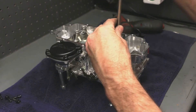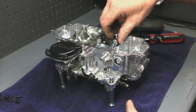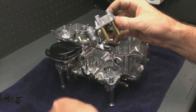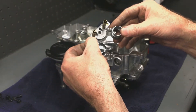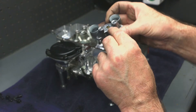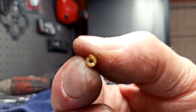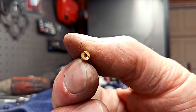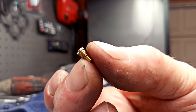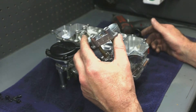The other thing you can do with these — which you can't do on a Holley without some clever drilling — is the booster assembly comes out, which is unique. Once you get it out, these ports are for the pump shot, for the accelerator pump. You can change the size of those from the bottom of the booster. And at the top of the booster there are two little jets in there — those are idle jets. So you can alter the fuel curve at idle and off idle in the transfer slot by changing these jets. So if you adjust your mixture screws and tip in the throttle and the car is a little bit lean just off idle, you can up the size of this jet to deliver more fuel to the idle circuit.